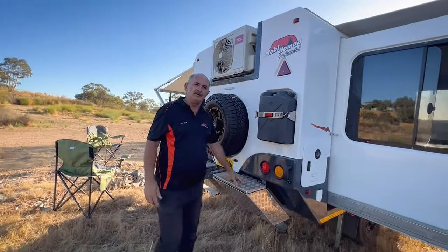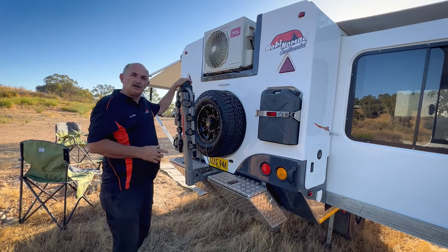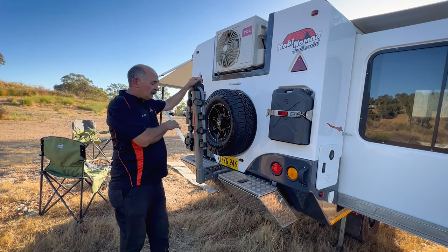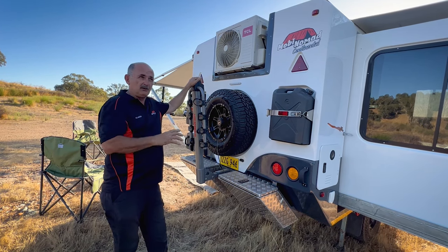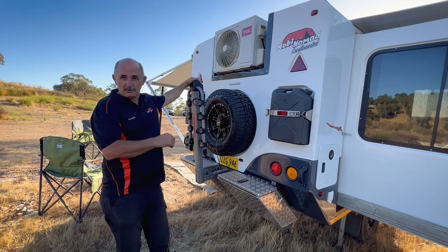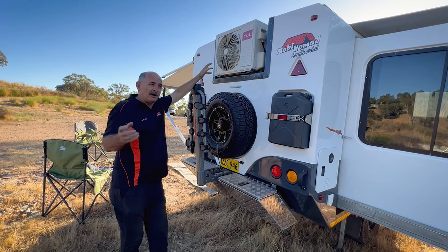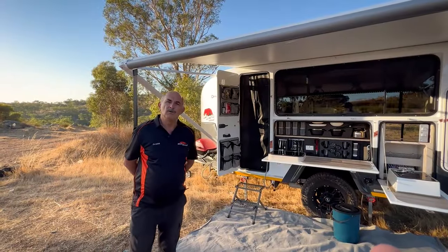Here you've got quite a few options. There's a sturdy chassis bracket that can take a bike rack, an e-bike, or storage boxes. It's very important to know the maximum capacity including the bike rack and boxes is 80 kilograms. Once you approach or exceed 80kg, the front of the Mobi can get light, so you need to be conscious of packing in the bathroom as well. And obviously this is the trademark of Mobi — exactly why we call it the hotel room on wheels.